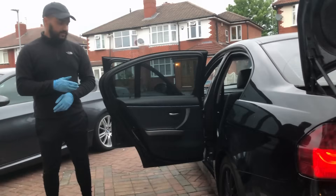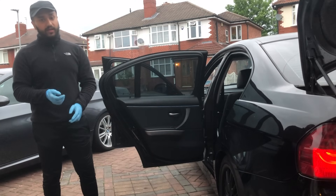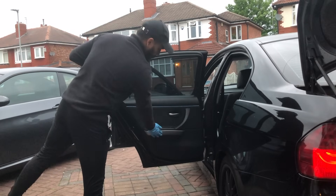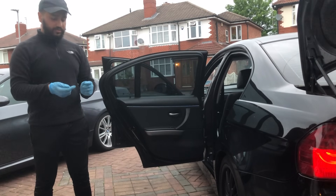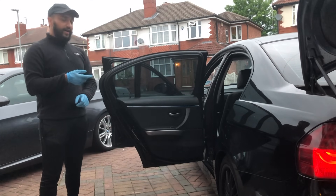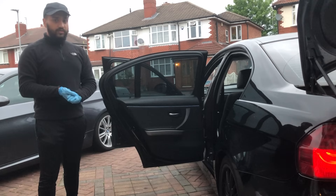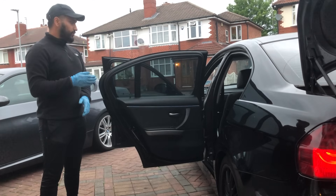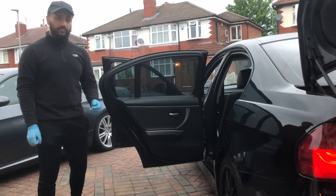We've fitted the EL wire into the back door card — it's pretty much the same for the fronts, just a couple more screws. For the front, there's one at the top and three screws instead of two. The wiring is exactly the same — make sure the brown wire is the negative and the red and gray is the positive. Once you've got that you can just tuck it into the door card and it's all done. I've got more mods coming for this E9X — this is an E90. If you like these videos please like, comment and subscribe, and if you need any help put it in the comments below.